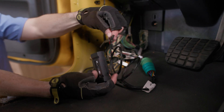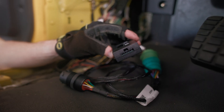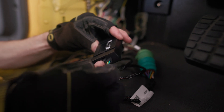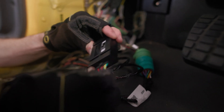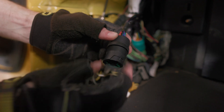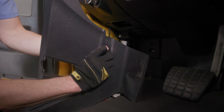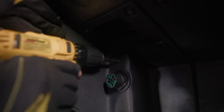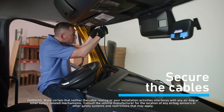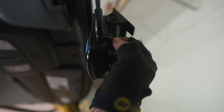Take the 6-pin connector and connect it to the CAN repeater. Plug the power cable into the 7-pin socket of the CAN repeater; the other end of the power cable will plug into the event recorder. Take the black end of the cable and reinstall the port. Securely route the cable along the vehicle's A-pillar in the interior headliner, then secure the cable to the side of the device with the provided T8 screw and tamper prevention clip.